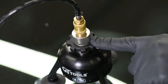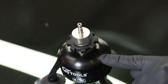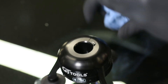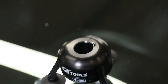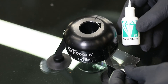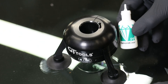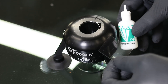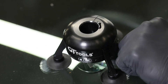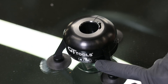Next, disconnect the hose from the Wizard injector and unscrew the Wizard injector from the Vanish Bridge. You'll have a little excess resin run down the glass — wipe that just up to the break with a towel. Now take your pit filler resin and a curing tab, and put a small drop of pit filler just above the break, let it run down into the pit area, and cover it with a curing tab. Then engage the curing one more time for another 30 seconds.